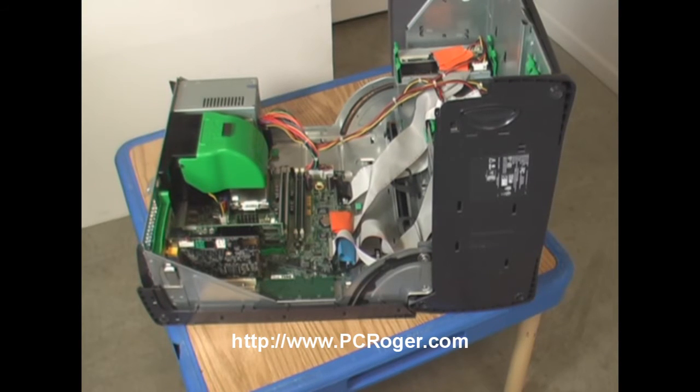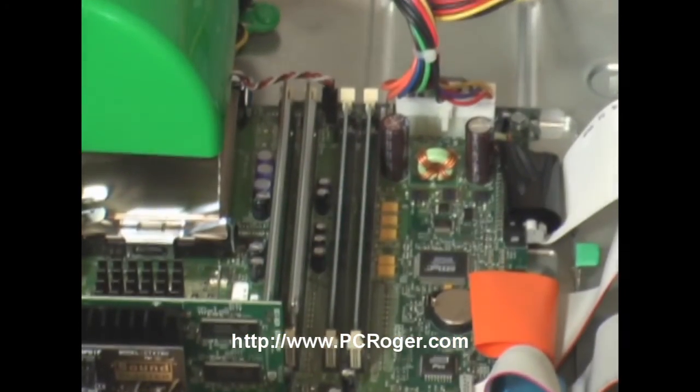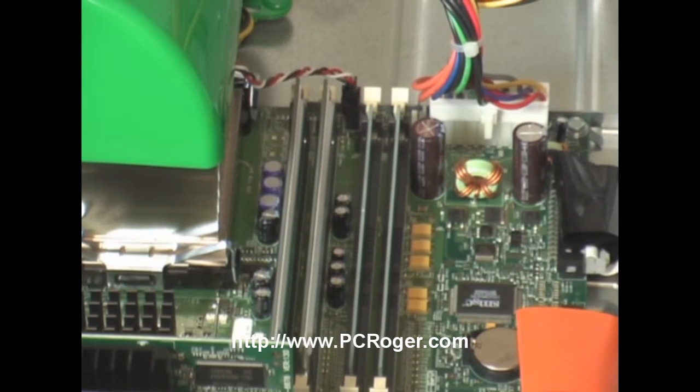As you can see, this is the clamshell-style case that Dell has. Here's our memory — there are actually four slots, four sticks. Currently the two on the left are the memory and the two on the right are just some kind of plugs that have to be there to provide continuity for the system channels. Everything has to go in in pairs, so those two on the left only work because there are two there — you couldn't get by with just one. Even on newer computers, you still want to put memory in pairs for maximum performance, even though it may not be required.